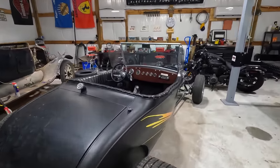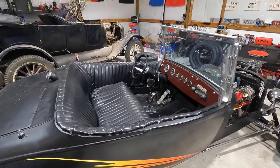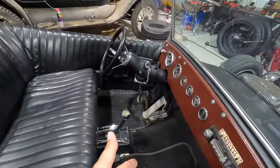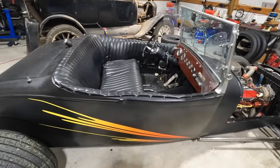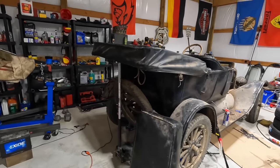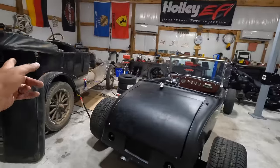And when it comes to things like T-buckets, they have no top. So they can't just sit outside in the weather or they're going to get damaged or destroyed. Believe it or not, T-buckets are still made of wood, just like the Model T. The floors in these are actually wood. So if you leave them out in the rain and stuff, yes, they're going to warp, deteriorate, and fall apart. So I can't keep all of these cars just sitting in the shop. I need the space to do some other stuff. So we'll probably be sending that one down the road.